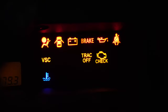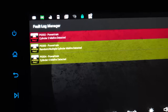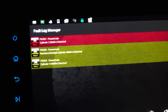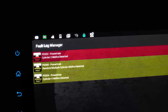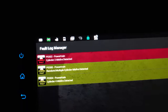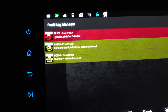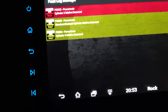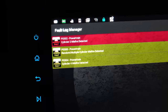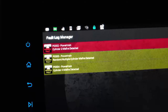Ignore the other lights for now because the car's turned off. This car's been having a little bit of misfire issues — it's had a pending misfire code for a while now. I've replaced the plugs, replaced the coils, and it still has been running rich and hasn't been having as much power as it should. About a week ago I ordered new fuel injectors for it. I've been delaying putting them in, waiting to find the right time, and then today these codes come up and it's forcing my hand.